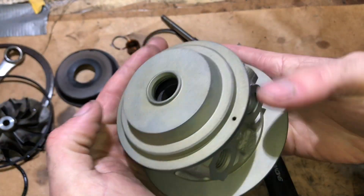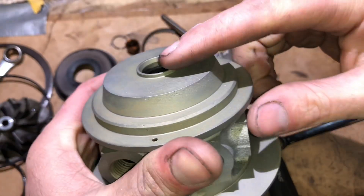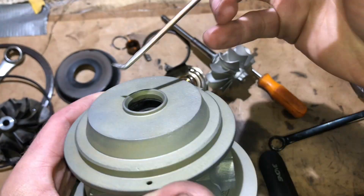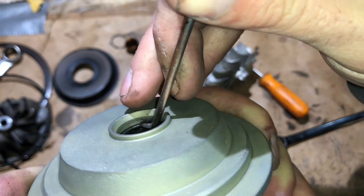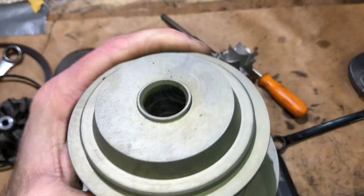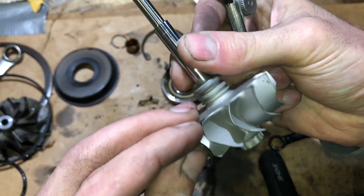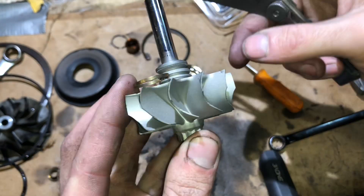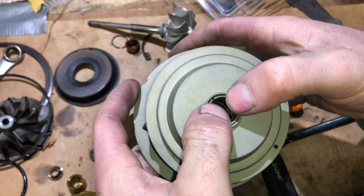I've cleaned it all up. We're going to put a piston ring seal down in there and measure the gaps, and clean out this groove right here. You can also take a little brass brush with a Dremel to clean that area out — that way it doesn't mess up any of the tolerances. Here's how you check the piston ring gap: you can either install it or just hold it up to it. Here's two and a half thousandths, which feels pretty tight — you can see it's got some drag to it. So this gap right here is still good. But even if that gap is good and the bearing housing is not good, it can still leak.